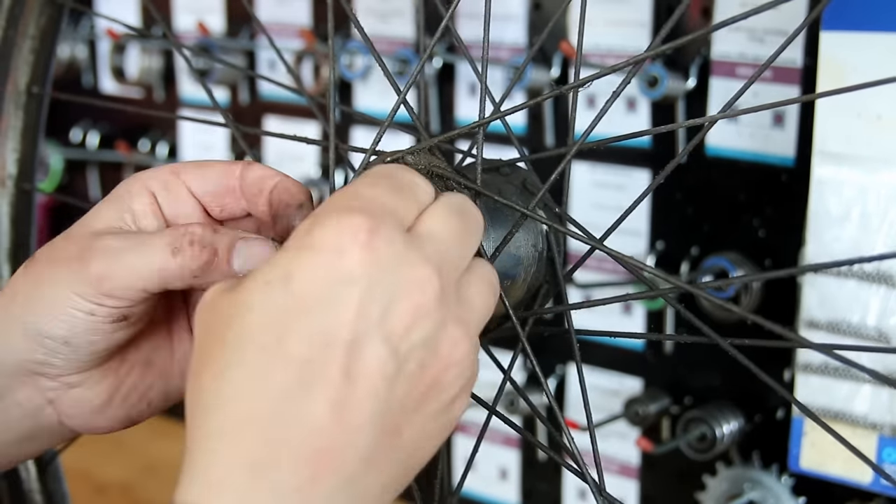It's a really nice single-speed chain going on there. On go the handlebars, on goes the shifter for the three-speed Sturmey Archer hub, then the handlebar grips which we've cleaned up. I'm using hairspray to stop those coming off again. The cockpit is looking really nice. I'm using general purpose grease on the brake components because they're adjustable — as the pads wear, those sliders are what you adjust on a bike like this, so we want them to slide freely up and down.